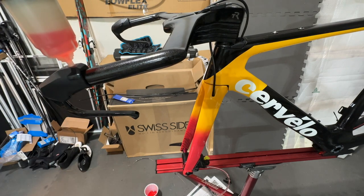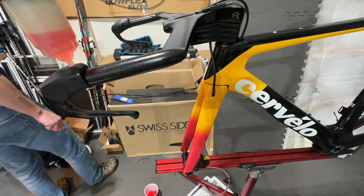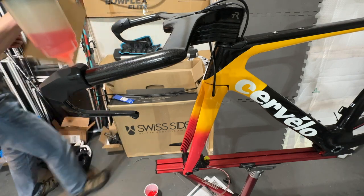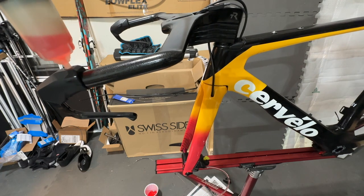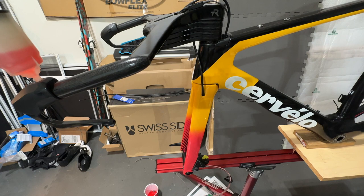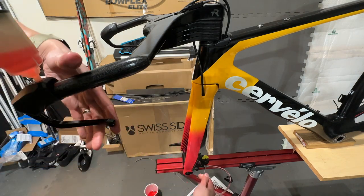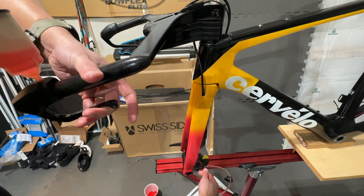Okay, now the hardest part is, or maybe what I can do, since I'm all by myself here, is raise it by putting it over a block of wood while keeping an eye on the funnel. Just making sure that there's enough fluid in here. And then I'll do the same with the air coming out. So I just do what Shimano said: hold this while I loosen this up.